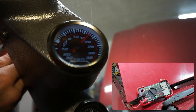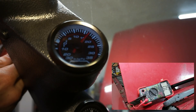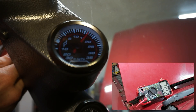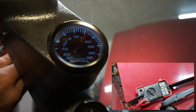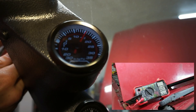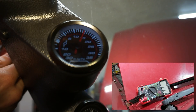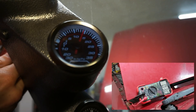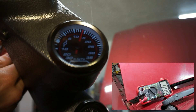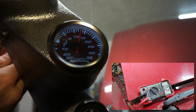And that's about 17 psi — so that would work pretty decent, but it seems like it's opening and breaking that circuit way too soon. We'll watch this thing bleed off pressure — now it's going back below 17 and it closes the circuit again. We'll see what it does while it's coming down and bleeding pressure off, and see if it actually opens the circuit in the same spot. It's really weird when it's pressurizing.